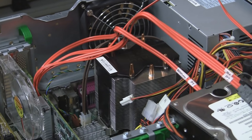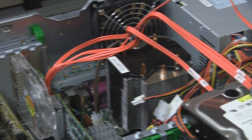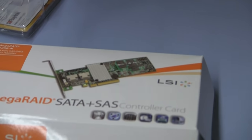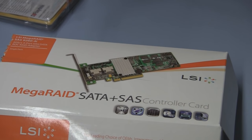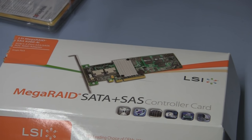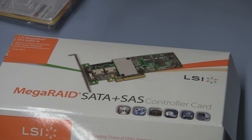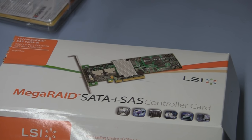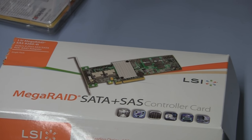What's really nice about this particular brand of SAS/SATA controller is it will support both SATA drives as well as SAS drives. Remember, SAS is Serial Attached SCSI. So if you want better performance, you would move to SAS drives. If you want high-quality RAID but are looking for a cheaper price, you can go with SATA hard drives and lower your cost on your overall RAID system.